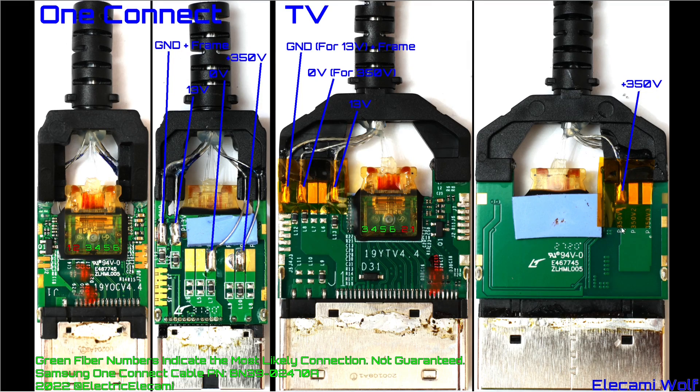They go over to there. Now, if you have a broken One Connect cable of this type, this is how you can reconnect it — well, in theory that's how you can reconnect it. The 350 volts goes on the big separate terminals and the 13 volts and ground there. The positive sides are marked with blue and the other ones are not marked, and that's only done at that end. On this end of the cable they don't appear to be marked at all, or maybe just a tiny dot up there.